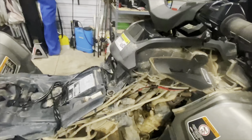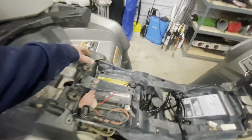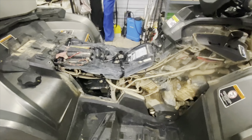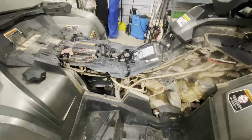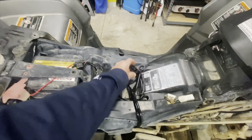Like I said, it's tight so there's not a really good way to run the wiring. This is just the way I did it. I tried to keep everything away from the exhaust - the exhaust runs up this side all the way to the motor and back - so I ran everything on this side. The wiring harness is going to be long because it's made for a vehicle, so you'll just have to find a spot to put the excess wire. I checked and nothing hits right under the seat, so I just coiled it up and zip tied it in there.